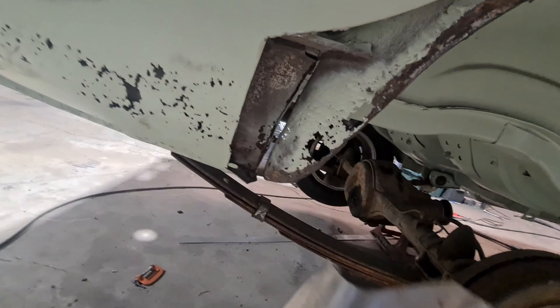Next up is the door skin — lower door skin and fixing up the inner as well. The inner is rotted out, so I'm going to peel this back, repair the inner, then make a new skin for the outer. This is just rusted through the whole thing — no point trying to save it. I'll buzz the lip off and repair the inner. The easiest way to remove skins if you don't care about them — just a rotted mess under there — is to buzz along there until you see it change, see the little hairline split. As soon as you see the split, you know you're through. Lift off — no trouble. That's removed and it is toast all the way through, pretty much ready to just break apart.